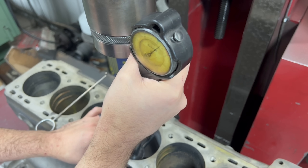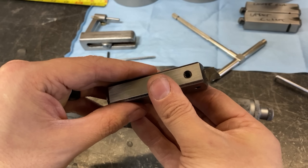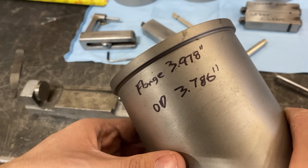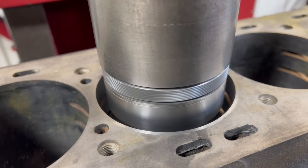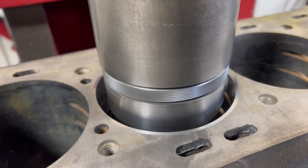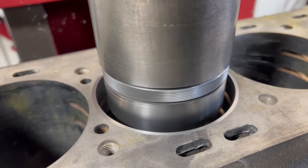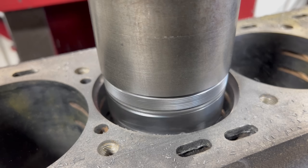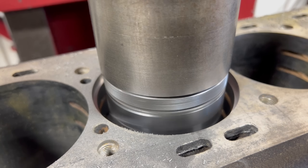With both sections of our parent bore looking good, the last cutter we need to set up right now is our counterbore cutter. It has a very sharp edge to give us a nice 90-degree corner in the counterbore, and we're going to set it to about a half thousandths larger than our nominal flange diameter. The flange of our sleeves is 250 thousandths thick, so we'll be cutting the counterbore to 245 thousandths deep in order to leave the flange protruding about 5 thousandths, which will be decked off later. As our cutter first touches the deck, you can see how low the deck is between the cylinders where it has apparently warped, likely from the same overheating that caused the cracks in the first place. Machining this feature is where a screw-up would be the most catastrophic, so we take our time and feed the machine completely by hand to avoid any chance of overshooting our mark.